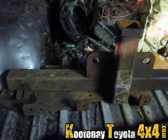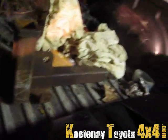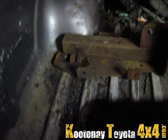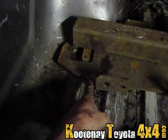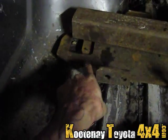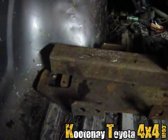I'm thinking about ripping that bar off and then maybe lifting the front of my truck with it — weld it between the frame and the front spring hangers, cap it. Actually, I need four of these. Because you cut it there and then pop a hole in them there, and you can make these into shackle hangers so you don't even have to use the stock ones.